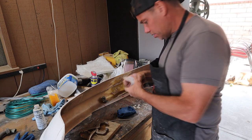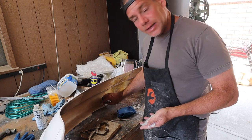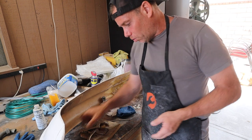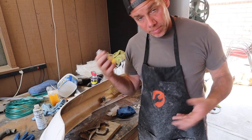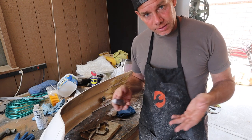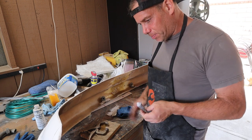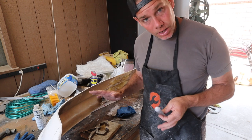I have cut a few pieces of fiberglass and I'm going to make this mixture on the hotter side, meaning I'm going to add a little bit more hardener to it, and that will make the stuff firm up a lot quicker than normal. Rock and roll, which I'm psyched about. And then this bumper will be pretty much done as far as mounting goes.